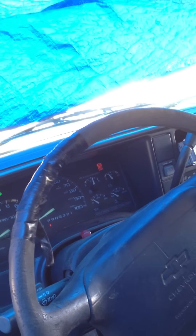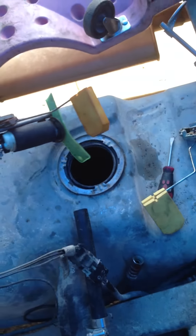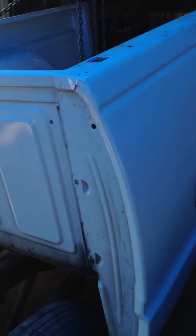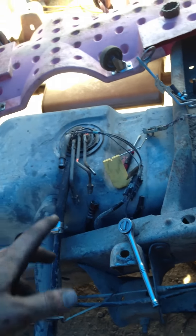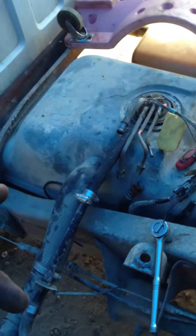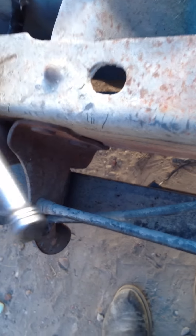That's it. All I have to do now is put the system back in the tank. It'll take about an hour because you have to take off the two tail lights, disconnect the wires, pull up the bed, and pull out a couple of hoses before you remove the sender. If you work faster you can beat that. Now, if you have the same problem — fuel gauge stuck up — it's usually said to be the floater system, or there is a ground right here that connects to this bolt, and if your ground is broken, that's also a common problem with the 1500.